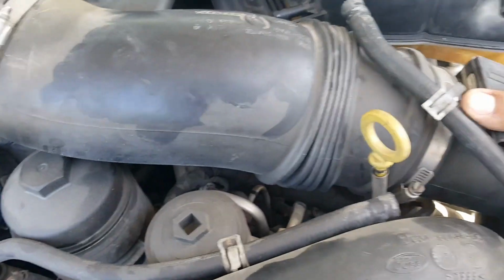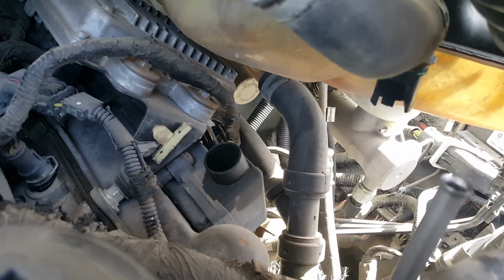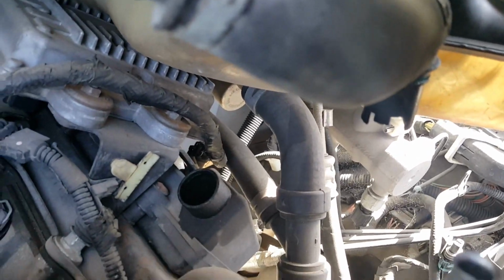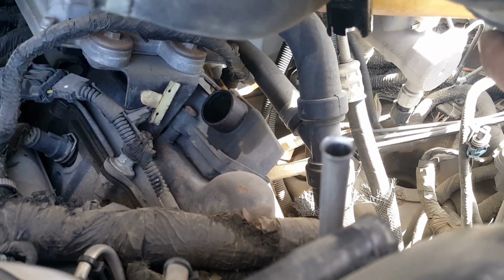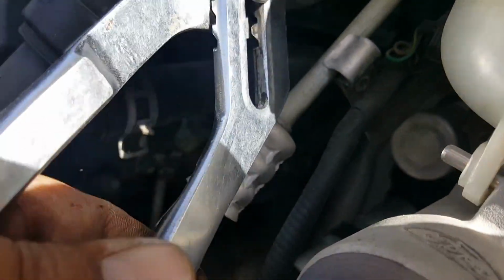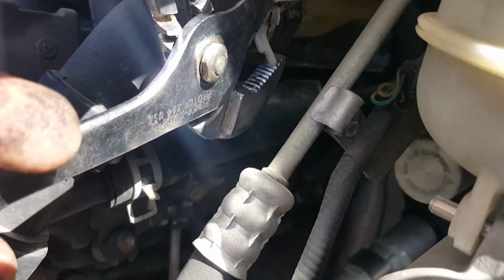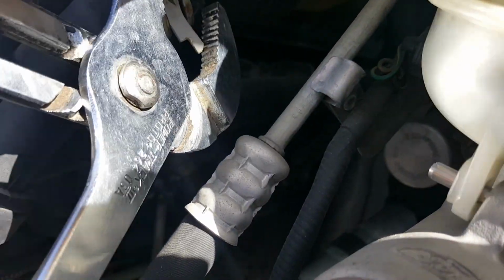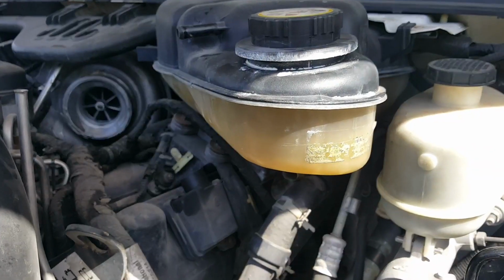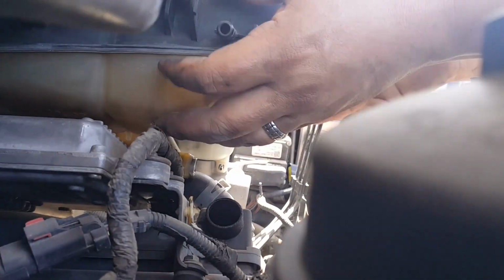Is there anything connected to it? No. Should come out. And that hose seems to go into that hole. I took out the dipstick. Disconnecting this bottom line of this to the reservoir, it should disconnect completely from the truck. Pull that hose up. This should free it.